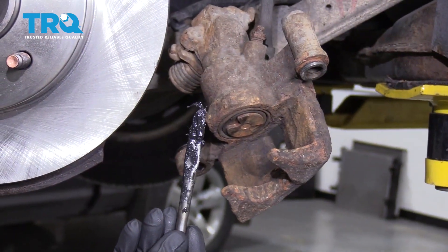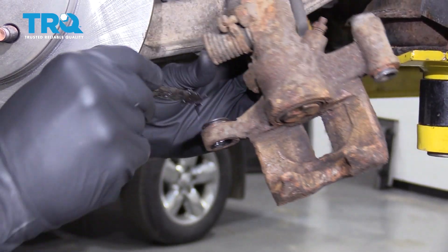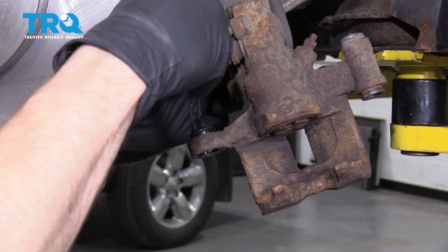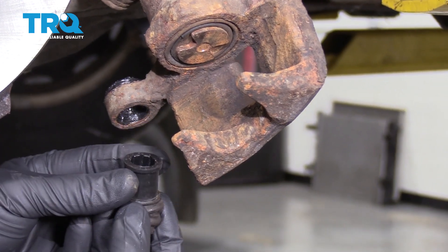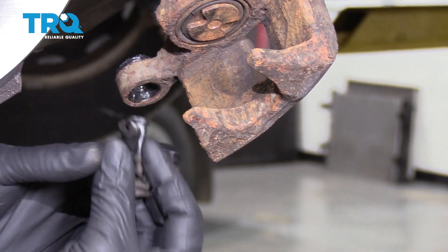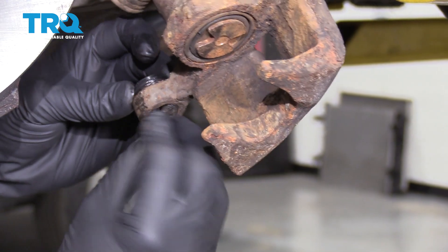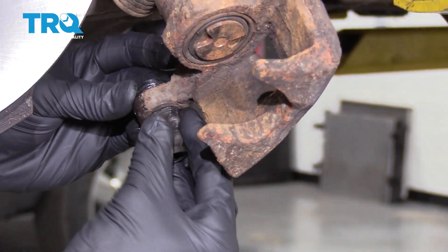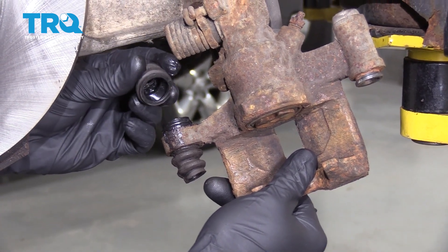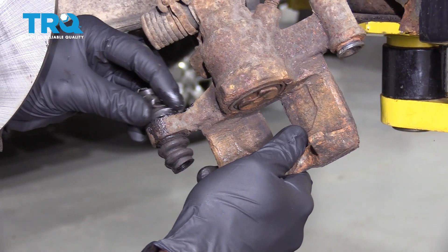Let's use some high-temperature caliper grease. Come right up inside this slider hole right here — that's the area where the boot comes through. Also make sure we get up along this lip. Once we put it all together, we can spin everything around and work in that grease as needed. Now go ahead and slide our boot in there — just gently squeeze it, roll it over, put it right in, and let it open up. Give it a little spin to work in that grease. Make sure the boot's protruding all the way out and it's flush. After that, slide the top boot right down and over that ridge. Give it a little spin working in that grease.